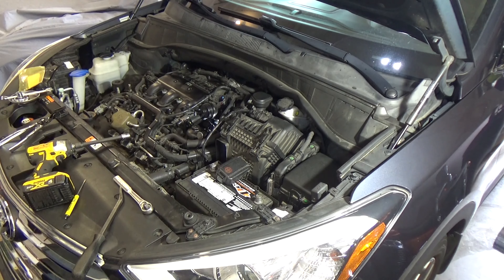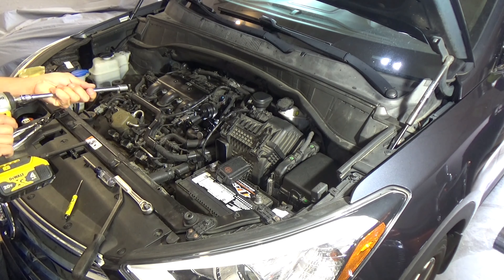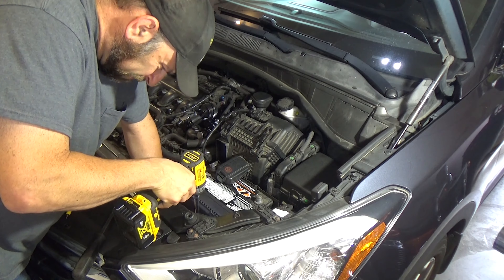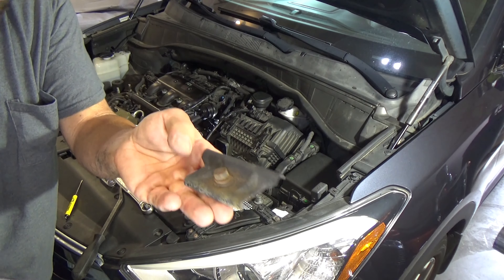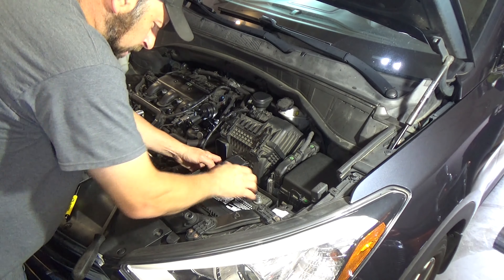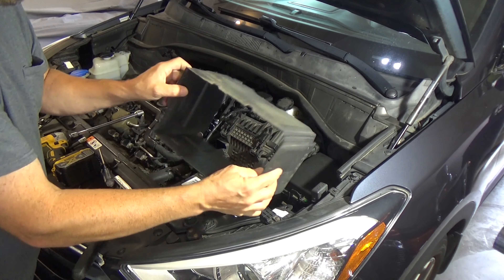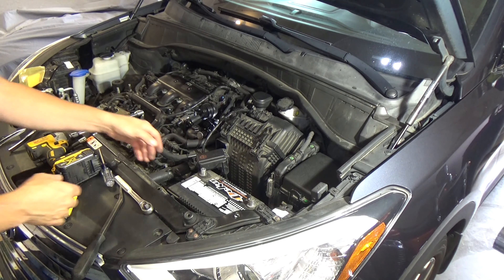So that's out of the way. I want to get the battery out. There's one clamp down there that holds this battery in — it's a 12 millimeter. We'll get that up out of the way. That just clamps down the battery at the bottom, and we should be ready to pull this sucker out. You can slide it forward. This one has an insulator around it — let's get that out of the way so we can grip this a little better. It just slips over the top, keeps the heat off it. And now we can yank this sucker out.